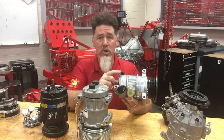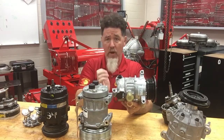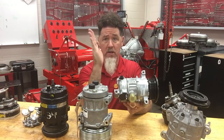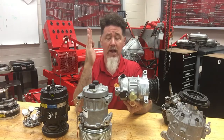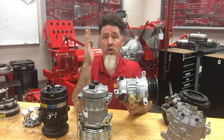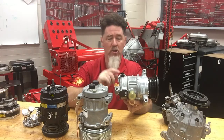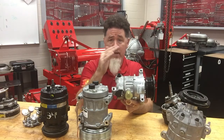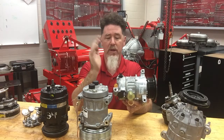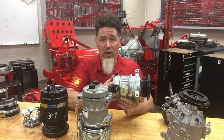If I don't want my AC on — say it's a mild day — I turn off the solenoid. With the solenoid off, pressure builds up in the wobble chamber, pushing the wobble plate straight up and down — vertical — and at that point it's not going to pump anything. If I turn my AC on and start increasing the duty cycle from 1% to 2%, 3%, 4%, 5%, it starts releasing all that pressure in the wobble chamber, slowly changing the angle anywhere from straight up and down to whatever the maximum angle is for that compressor, going higher and higher up to maximum displacement.